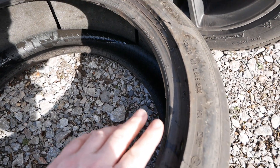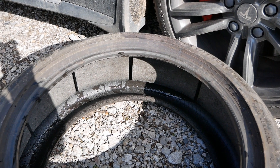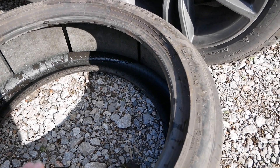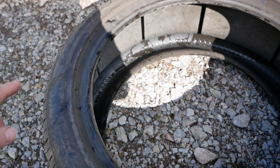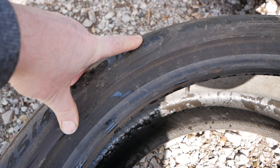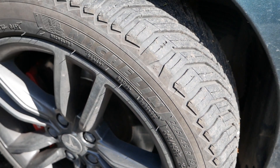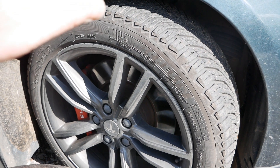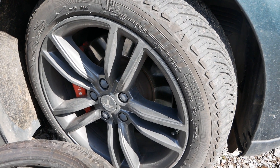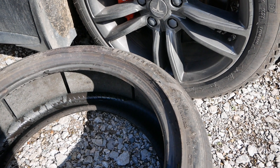Another common question is: if my vehicle has acoustic tyres from new, or if my Tesla has a T0 or T1 spec tyre, do I have to fit the same? Again the answer is no. You obviously have to fit the right spec tyre — the right size, in this case 245/45/19, and the appropriate speed and load rating — but apart from that you can fit any tyre you like. On my own Tesla I've actually got Michelin Cross Climates now, because I prefer those for the UK climate. In winter they're an awful lot safer than a summer tyre, and our UK winters aren't bad enough to justify buying dedicated winter tyres.